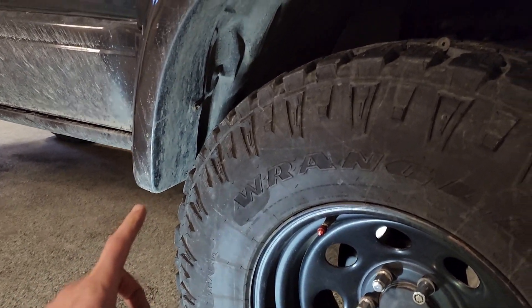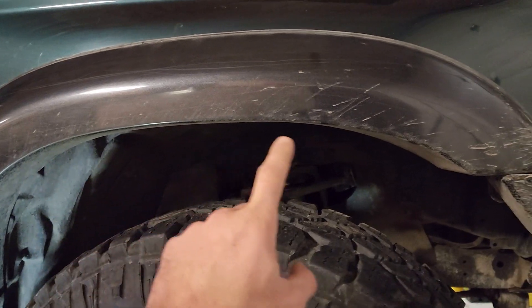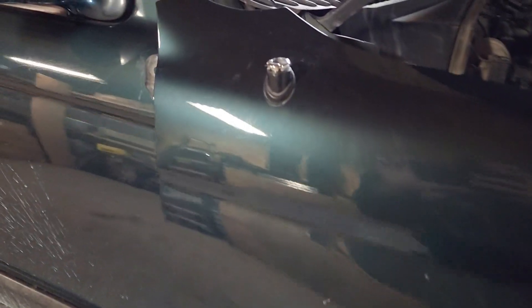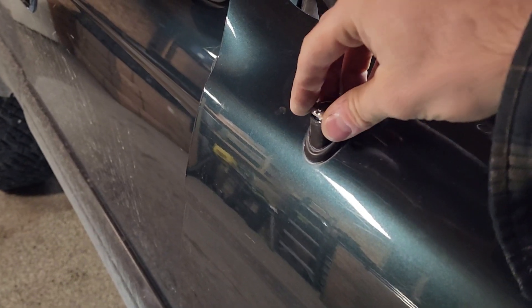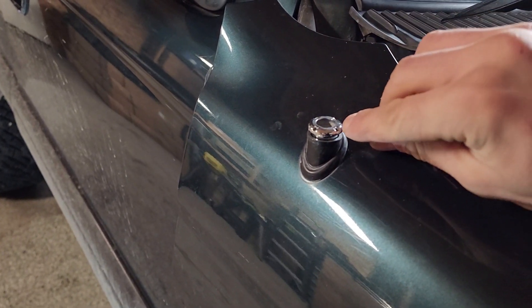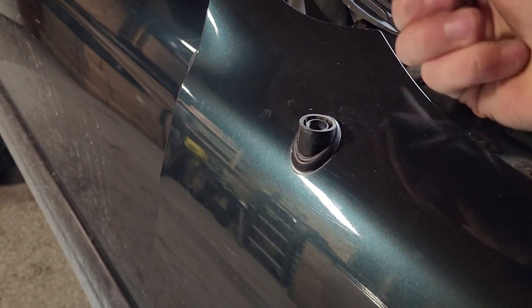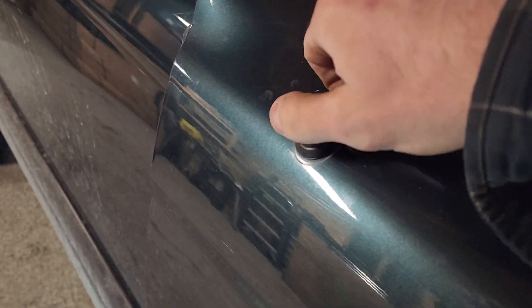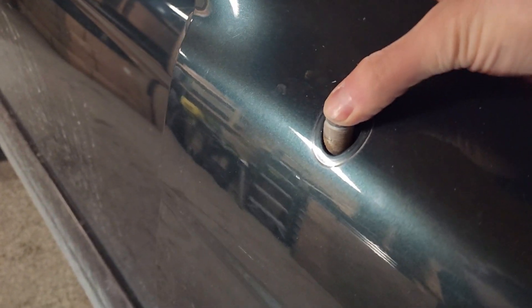I got all the bolts off - there was one little bolt just under there holding the fender, and a couple clips in the liner - and that's about it, it's all loose now. While you're here you can actually take this off as well. Mine's already loose, it just screws right off. If yours is tight you may have to put a little screwdriver here and just tap it with a hammer, but it should just screw off.